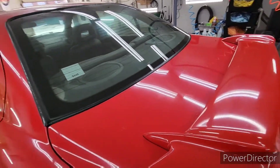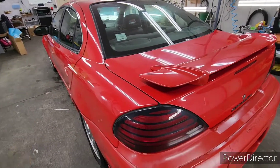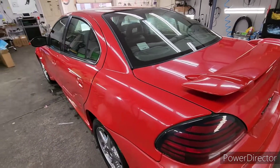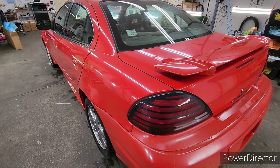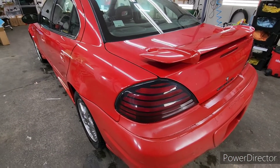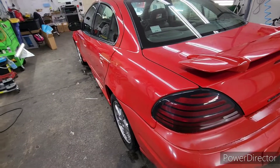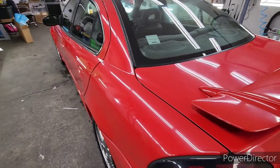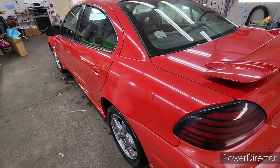New cars are just not designed to be buffed any more than just a light polish — they're really not. If you've got a ton of scratches, it is what it is — clear coat restoration is the way to go. The car will look like it's been repainted. Two layers of clear coat — it's a lot of work, kind of like repainting. You cure it, scuff it up again, put it back down, polish it, then ceramic coat it. It would basically be a brand new paint job without spending about eight grand, which is what the average car costs to be repainted. Anyway, thanks for watching!